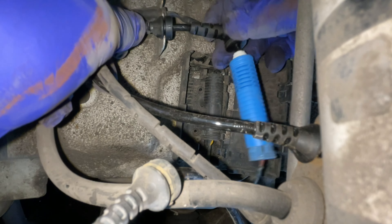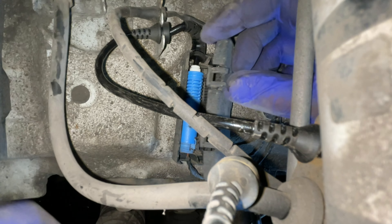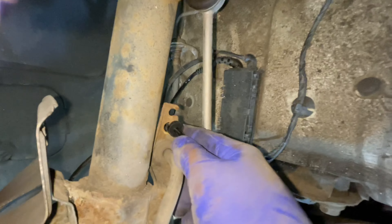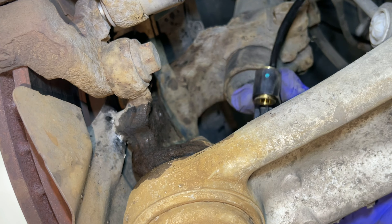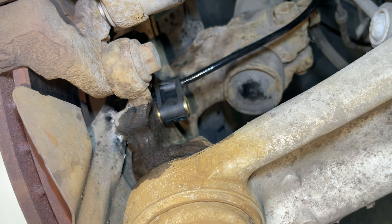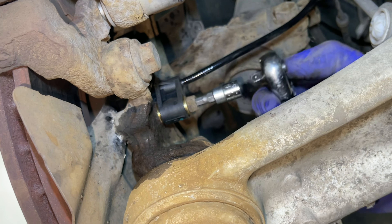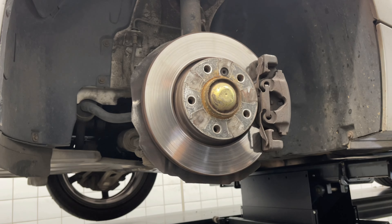Place the plug back in its protective box, making sure it's properly seated, and then secure the cable just outside the plug box. Then secure it behind the suspension again. Finally, insert the ABS wheel speed sensor back into its mounting hole. Some people apply a little red rubber grease, which will make the job easier next time. Once tightened, torque the bolt to eight newton meters — that completes the replacement of the sensor.